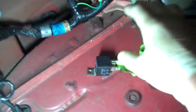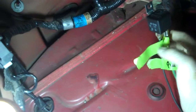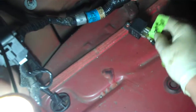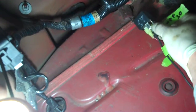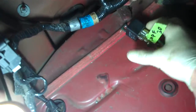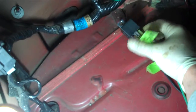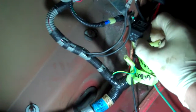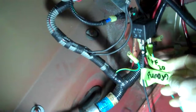I'm going to show you — this is the 30 amp relay that I'm using. What I did is I got this schematic and I put connectors on it and labeled each one to the appropriate port on the relay, and I put flag labels on each one to tell me which wire I have to connect to this relay and where it needs to connect to. What's going to end up happening is I'm going to put this relay right here, using the bottom mount for the FPDM to mount this relay, and then I'm going to one at a time unplug each wire from my flag labels and plug in the wires that are needed.